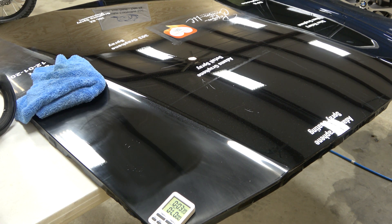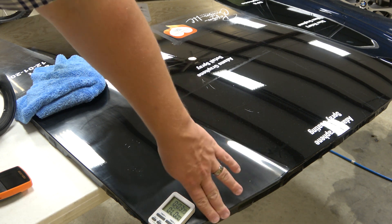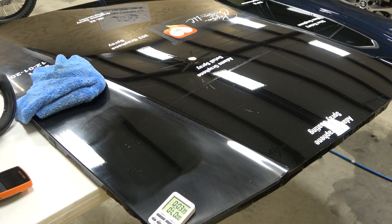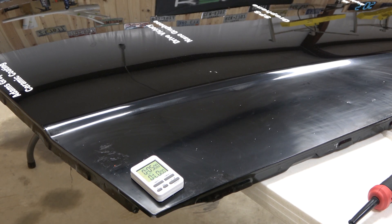So really, when you think about it, it's a lot harder to burn through than you'd think. With a rotary you have to watch out for edges — that's quite frequently where it happens. But if you burn paint on a flat panel like this you're really doing something wrong. We're going to move over to the other side to try the dual action polisher.